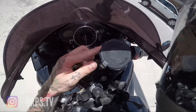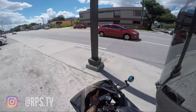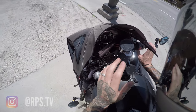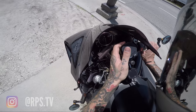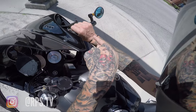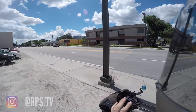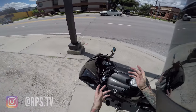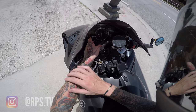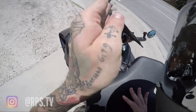It'll switch over and you're gonna see your diagnostics and the different codes you have. D116 is your throttle position sensor — sitting at 16, and anywhere between about 12 and 21 is correct with the throttle closed. When you open your throttle all the way, it'll show the sensor sensing 94, and I think somewhere between 88 and 102 is supposed to be good. You can see information on all these — they'll be like different temps or barometer stuff. Hitting select goes up through the codes, hitting reset goes down.